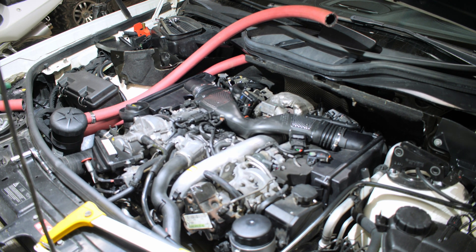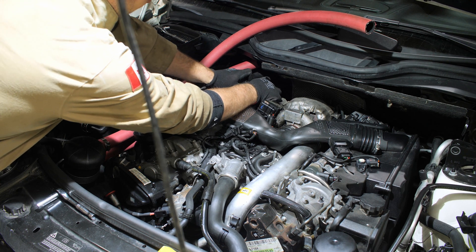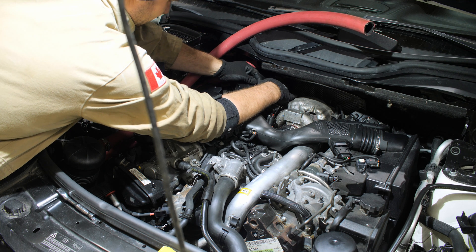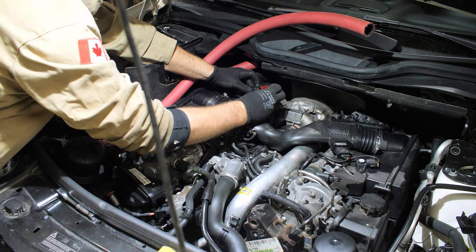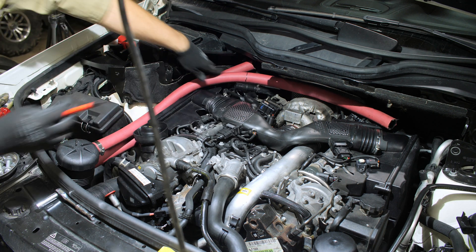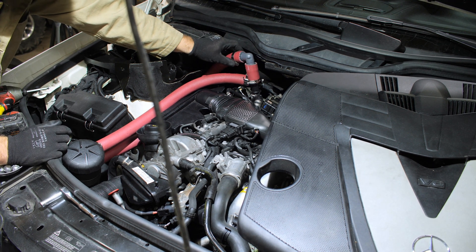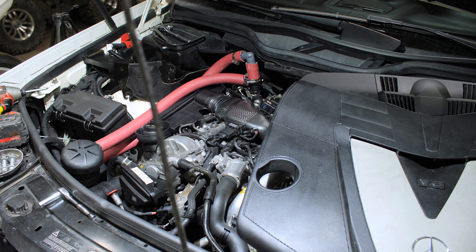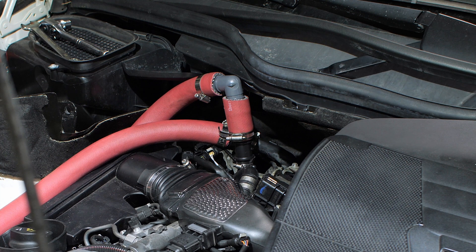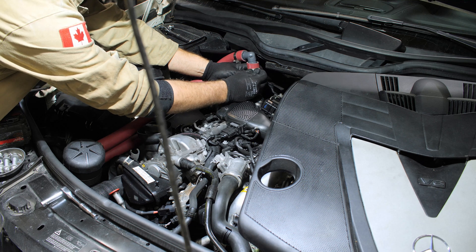Make sure you've got those hoses lined up in a good spot. I cut the crankcase vent hose in the flattest spot — it's kind of a weird hose that makes a bit of a roll then flattens out and expands, so I picked a really nice even spot. Because I had those 90s I was able to manipulate the big hose. Once you cut the crankcase vent hose, there's no turning back. You're then ready to put your 5/8-to-1-inch fitting in. I only ended up needing one 90 to make mine fit. I marked up the hose, cut it, put the 5/8-to-1-inch in, then needed a 1-inch to 1-inch piece of hose going from the 5/8-to-1-inch adapter to the 90. That little setup was tucked underneath towards the firewall.